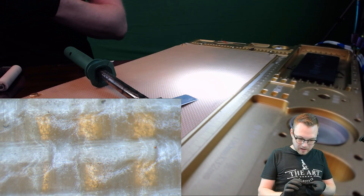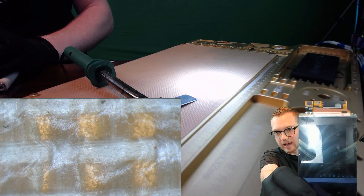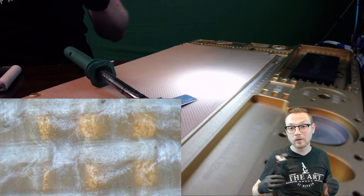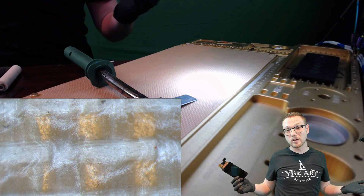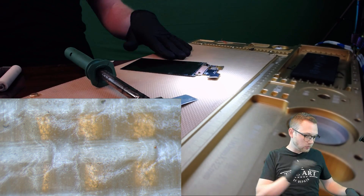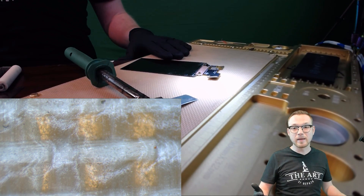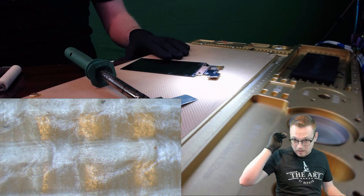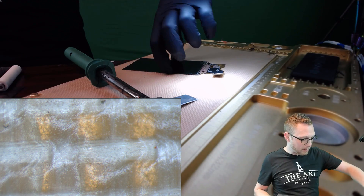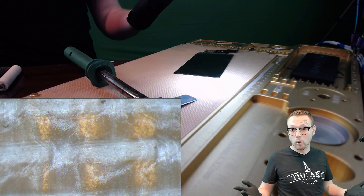So we have a Galaxy — I believe this is a Galaxy S7 AMOLED display — but it's got an issue. That's something we're going to talk about in a later episode and how to avoid it. But today, we're going to talk about how to get that polarizer off because that's where the damage is. The polarizer itself sits directly over the actual display panel on an AMOLED, or on an iPhone, same thing. As soon as that display panel stops, you get a little bit of adhesive and then it's polarizer time. We're going to take a look at the polarizer in the microscope and analyze it for a weak point.